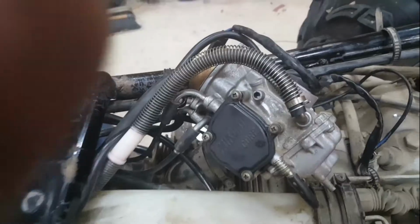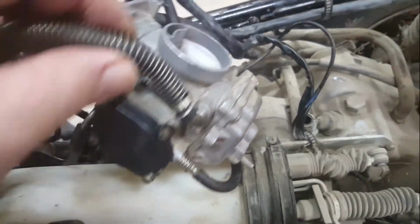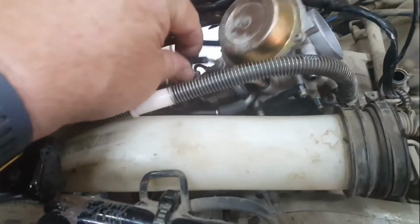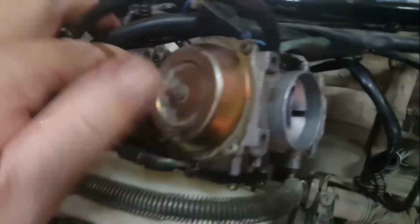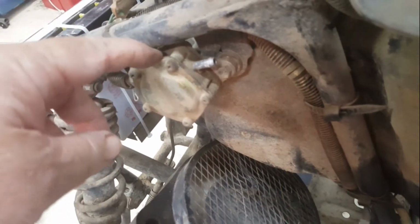carburetor. That's the hoses back on, the cover on the throttle fuel line. This is the one that goes up to the T-piece at the top there. This one on the top of the carburetor goes to the petcock, and this little one down the side goes into the plastic fitting there, the white plastic fitting. It goes round to the back of the fuel pump. Over here it's the pulse line for the fuel pump.